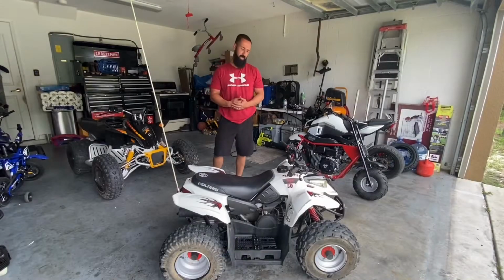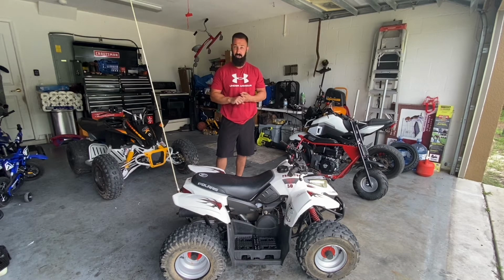Okay, guys, that's pretty much all I got for today's video. If you're going to go look at a machine that isn't running, the main things I would suggest bringing with you would be a jump box, just in case the battery's dead. I'd recommend some starter fluid or some carburetor cleaner, and then I'd also recommend a good compression gauge, just so you can make sure internally the motor is healthy. But like I said, you need fuel, air, spark, and compression for a motor to run. If you don't have those things, the machine is not going to run.